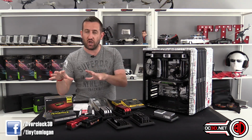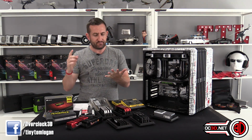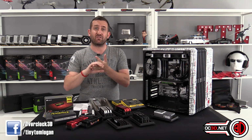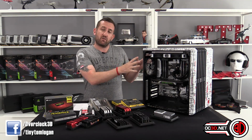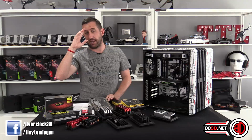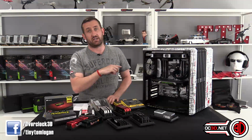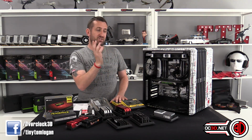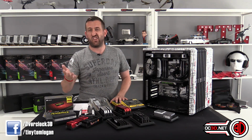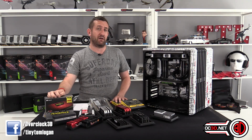And when you go into the BIOS and you have a look, there are three main voltages that you need to keep an eye on. You've got the system agent voltage, you've got the VCCIO, and you've got the cache volts. Now, as I've already said, this has got the overclock socket on it. So the one that I'm watching implicitly is the cache, because with the old X99 Carbon that I did before, you could have been looking at 1.3, 1.35 volts for 3000 megahertz. For 3200 megahertz, it didn't go above 1.48.